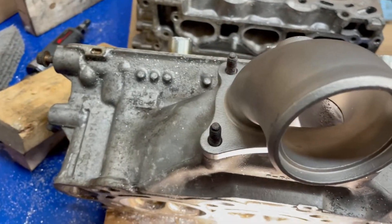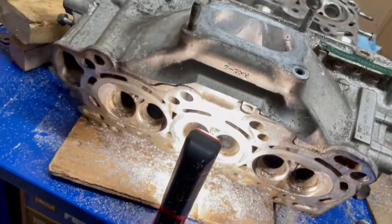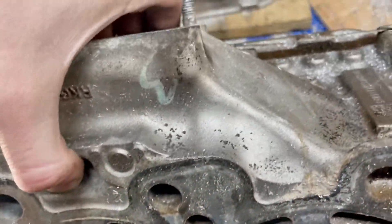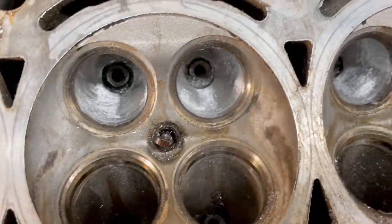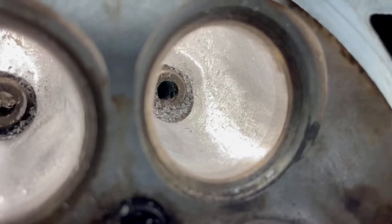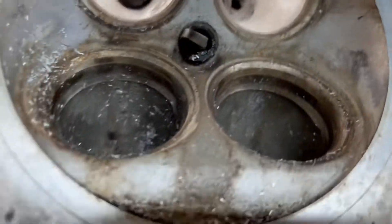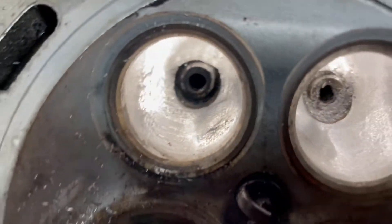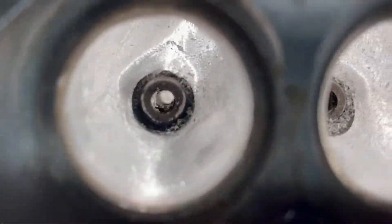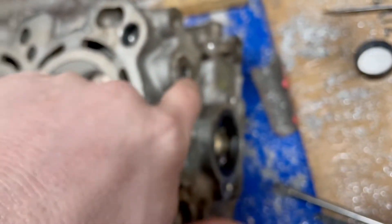Right now I'm polishing and smoothing out all the bores - I've played around with my cartridge here. You can see they're starting to get a little smoother, all the ports are getting smoother and more blended in. I've worked the valve guides a little bit. I'm going to get rid of a little burr there. You can see here this is a rough shape one - the sides are not very smooth. Then this one here has a little bit more polishing - you can see it's a little more blended in.